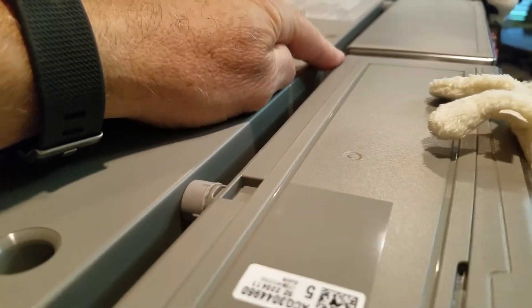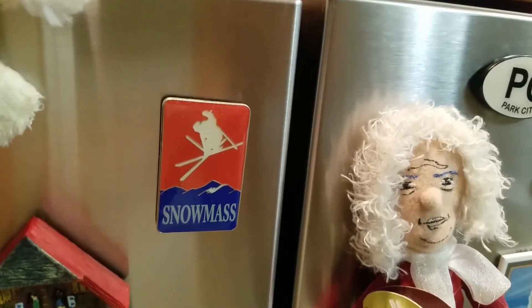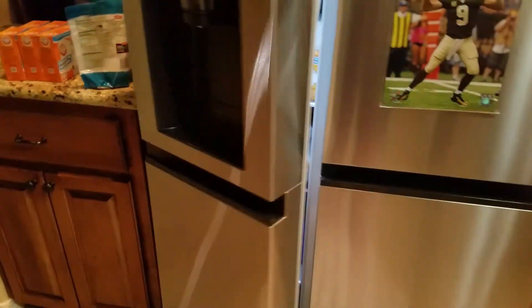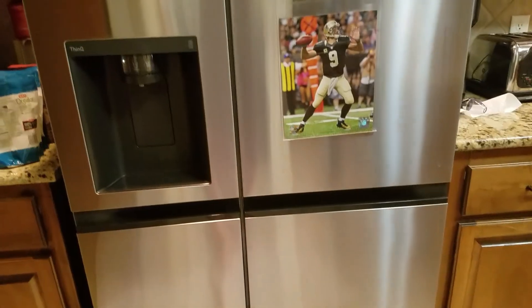We're going to level the refrigerator. You can see this one looks a little high compared to this, and this one looks a little low — the doors are not perfectly level. You have to open the door and get to the leveler this way — long side — and turn it to the left to raise it. I can feel it working on the ground. You can see they're level now. When you have the door open, I have it measured so it won't hit the counter. Just push it shut a little bit and it'll go all the way — it's got a pretty firm shut to it. Same on the other side — not going to hit the counter. Just shut it a little bit. So you've got auto-shut — pretty heavy shut-off.